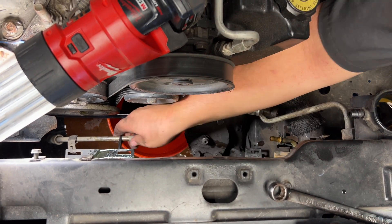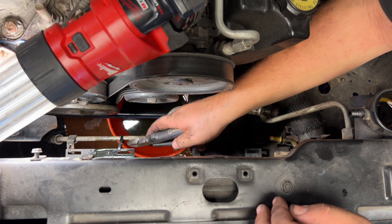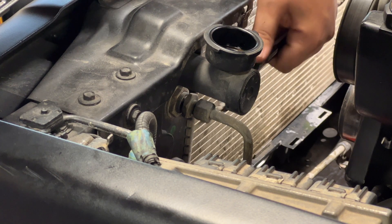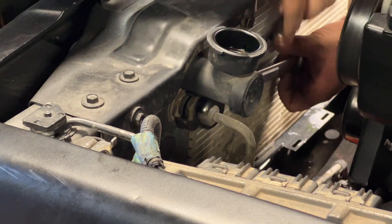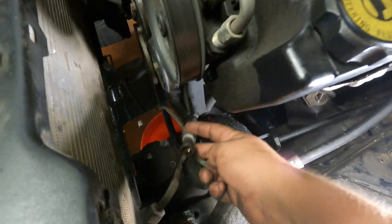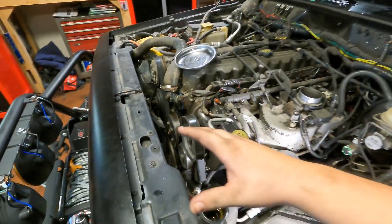On the bottom of the radiator there are some mounting points — both of mine were zip ties. There's some kind of bracket holding the upper cooler line, and the upper line is threaded in with a three-quarter inch collar and a fifteen-sixteenths on the back. Some transmission fluid came out — not from the hose but from the transmission cooler itself — so keep that in mind and be prepared to check your transmission fluid level after the job and add some if needed.